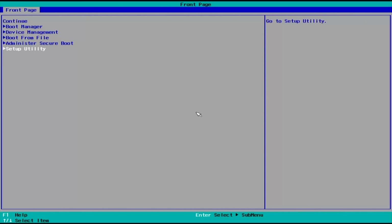And then this is actually the setup utility, the actual BIOS. Now for the password. If the password that I have in the description doesn't work, try the other one, the one that was on the very old BIOS. If that doesn't work, you will need to downgrade the BIOS. I'll share the link to a document describing exact steps. It's very easy. Once you downgrade the BIOS, you can go through all these steps that I'm just showing you. So let's enter the password.